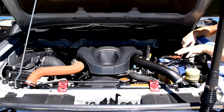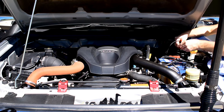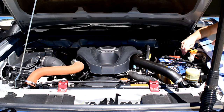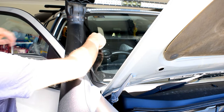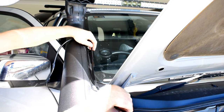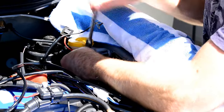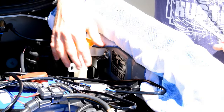Before fitting any wiring harnesses to the vehicle, I just mock up where it's going to run and where the relay is going to mount. I've decided to mount it over here — it's nice and close to the battery and easily accessible. I can fit my power and earth to the battery, run my light bar wiring across there and up the windscreen, and run my switch wiring down through the firewall grommet into the vehicle. I've decided to run the wiring down this side of the vehicle so the snorkel hides it a little, running it up under the trims for a neater look.